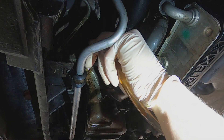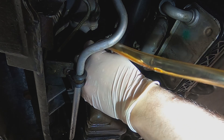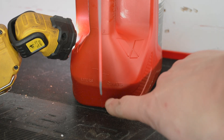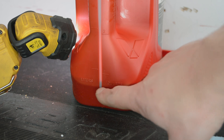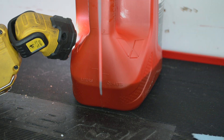Now back up to the angle gear. The old Volvo spec was to fill it until it came out of the fill hole, but that is no longer accurate — you want 0.75 liters. Looking at what I took out, it looks more like 0.5, but I was leaking and I'm not sure how much I lost. I put 0.75 liters back in and it didn't reach the fill hole, so that seems accurate enough to me.